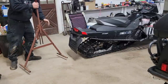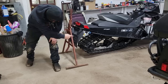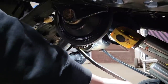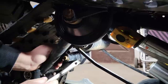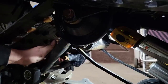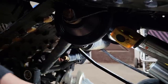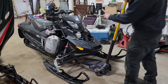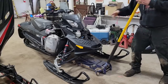Let's grab the fancy snowmobile jack thingy. We're just going to tighten up the spring tension on the rear. All these sleds with the springs are pretty much the same — the spring is held down at the front, and you've got your small tail end that goes up on these bars. You've got plastic blocks with different heights — different numbered positions. Every time you raise a position it puts more tension on the spring. It was on number three; let's go up to number five. That one's cranked to the max. I cranked up both rear springs.